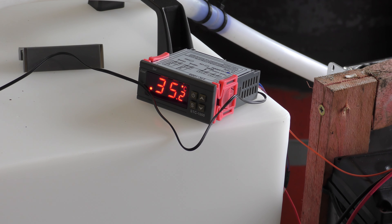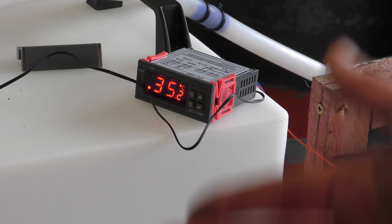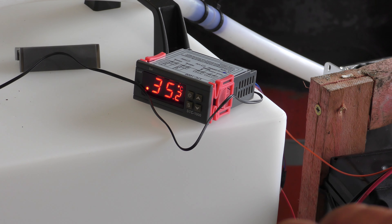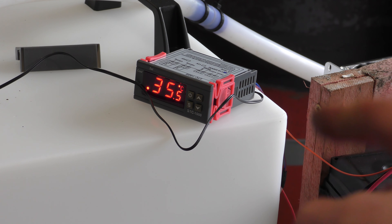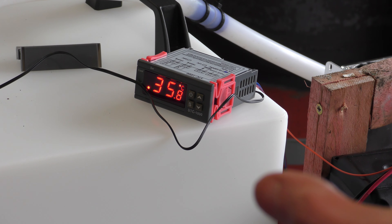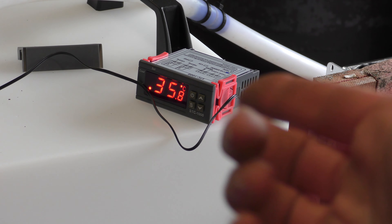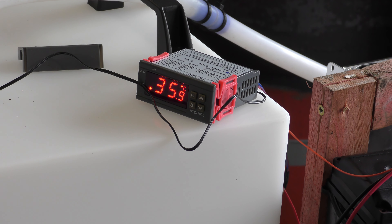This should get to 36 and then click off, and then the Webasto should click off and thunder down. On these controllers, obviously you can set the temperature you want to get it to, but you can also set the temperature that it turns back on at. I've set this to 10 degrees, so it would have to drop down to 26 before it turns back on again. But you can set it within half a degree if you wanted. You don't want to be bringing the Webasto on and off that quickly, so you could do 5 degrees — once it drops 5.